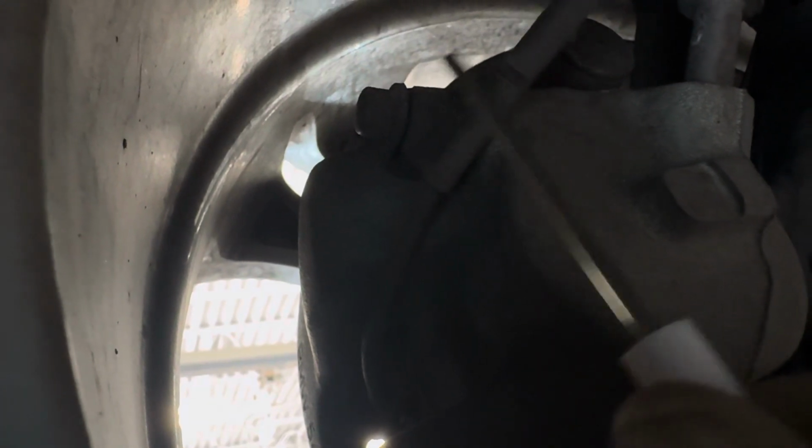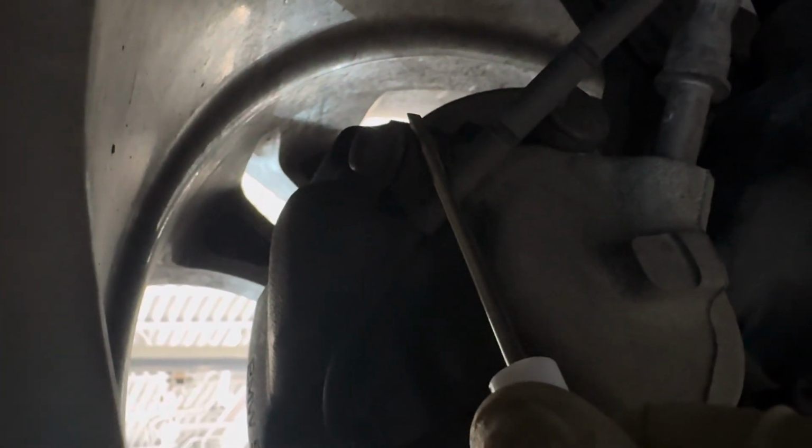However, for this bleeder valve, or some of the bleeder valves on the vehicle, your wire is in the way of the bleeder valve bolt to open it and close it for when you're flushing it. It's maybe a little difficult to see, but there's this wire and a little rubber grommet there, and you'll just pull that out to give you a little more clearance, and then you'll uncap this guy, and that will allow this to slide off and give you access to that brake bleeder valve. As you can see, just went ahead and undid it, so just pop that off with a screwdriver, pocket screwdriver, or something to pry on, and it just lifts off just like that. Gives you plenty of access for your bleeder valve. And you're going to repeat this process on all 4 of the calipers.